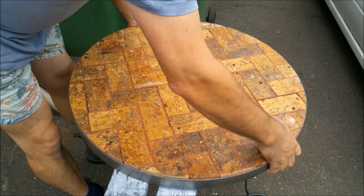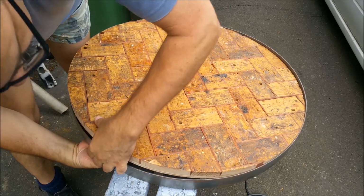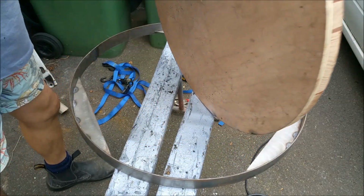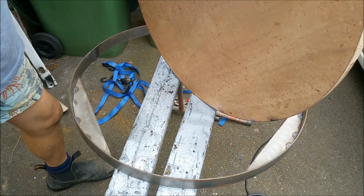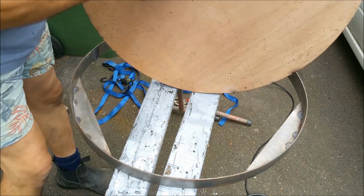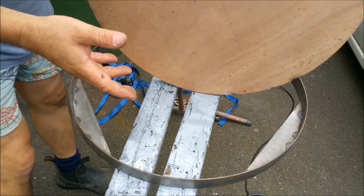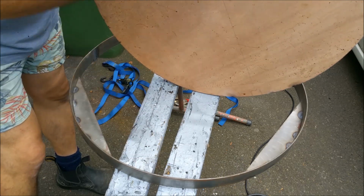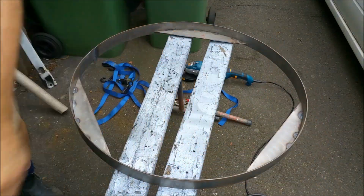When we did this, I got Alicia to, whoops, here we go, mount it on a bit of ply. You can see I've been welding to sort of tack it together, so I have to tidy that up. And I put a half inch hole and made a jig. So there was a half inch piece of dowel sitting on a piece of wood that was clamped to the table saw, and we rotated this as the edge of the saw was cutting it into a circle. Let's move that for a moment.